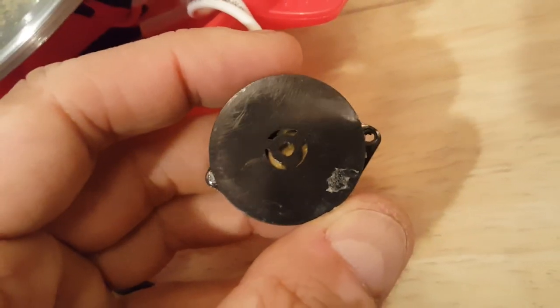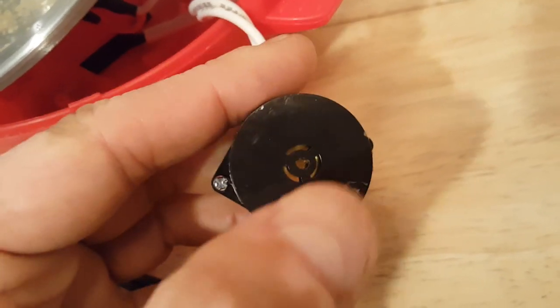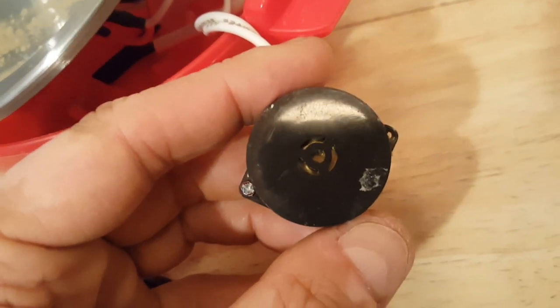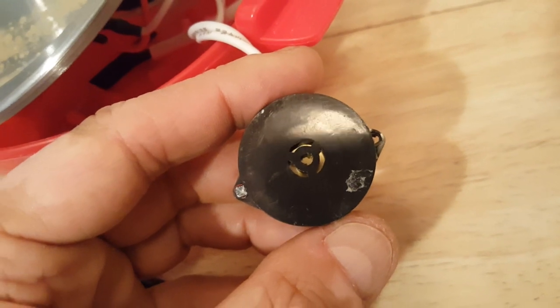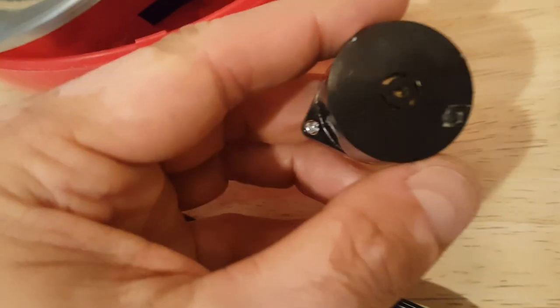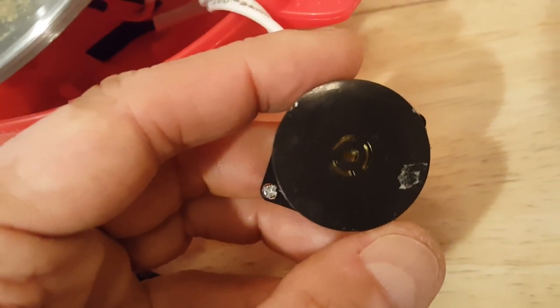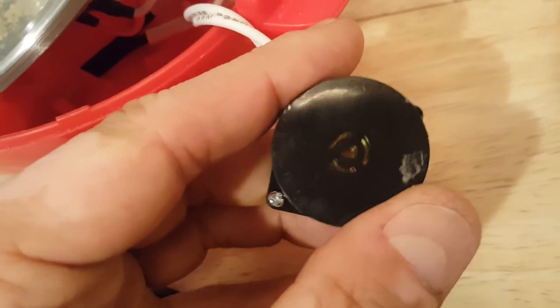The issue is this is not a regular speaker — this is a piezo buzzer. Just covering this hole will mute it some, but it really doesn't do the job. Because a piezo buzzer works unlike a regular speaker, you can't just puncture it or put a piece of tape over it and really muffle it. It works off of vibration.